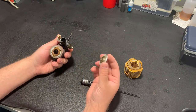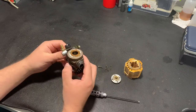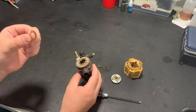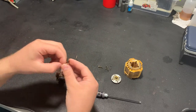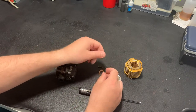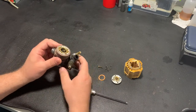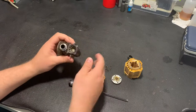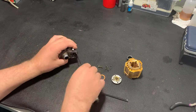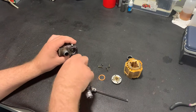Top of the engine looks not bad. So, the washers that I used for compressing, to change the compression level of the engine. Next step, I will remove the back plate and we will see the crankshaft with the conrod and with the piston from the other side.